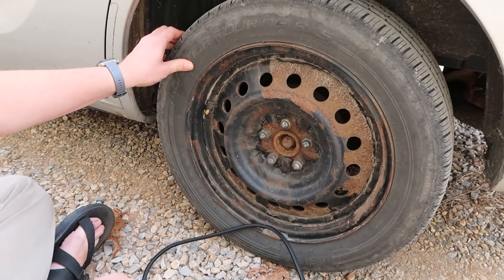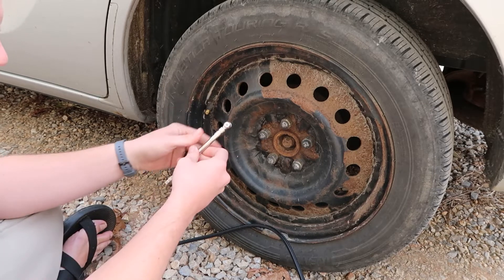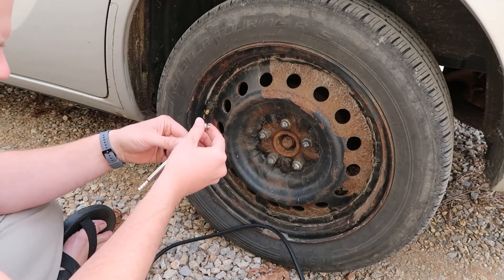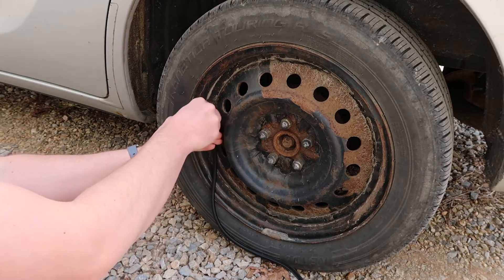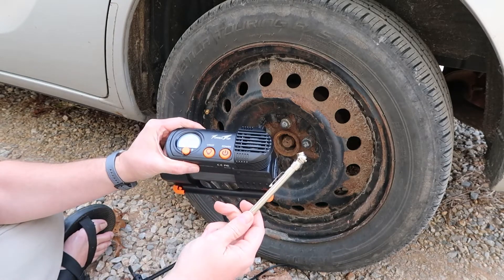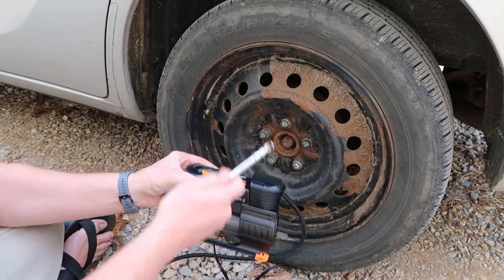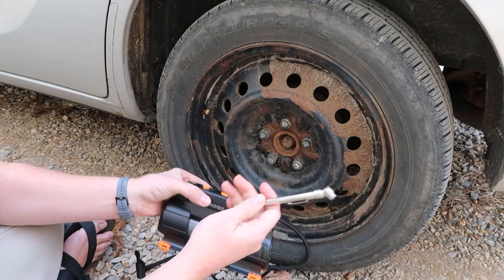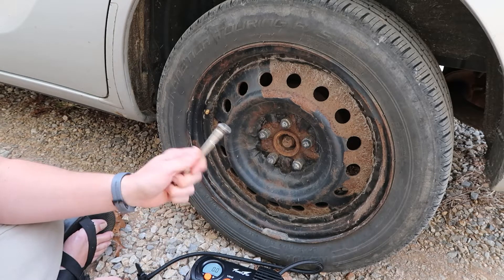I like to see them a little bit closer. Let's go ahead and try it one more time here. It's at 36 or 37 — 36. Let's put a little bit more in there. So about 39 to 40 is where we're at now. So is this right or is this right? I'm not sure. But having it right there on the edge — this tire is rated for 44 psi. So I'm happy. If it's at 43, great. If it's at 40, okay. Both of those are alright in my book. But I just was hoping to see a bit more consistency between these two.